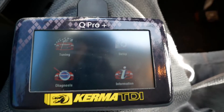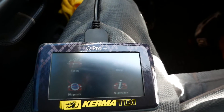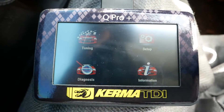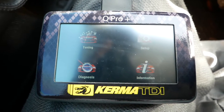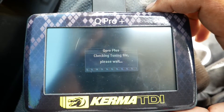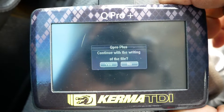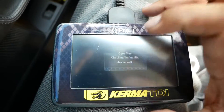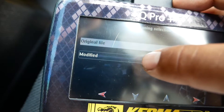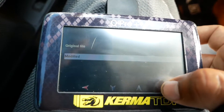So we are back and we plug the Q-Pro Plus with the new file on it into the car. Now you're going to put the car in the on position — remember that. We're not trying to turn the car on, just leave it in the on position. Make sure all your lights and everything are turned off because this does take 10 to 15 minutes. We're going to go to Tuning, looking for the file. We're going to hit Yes. Then we have the original stock and the modified file. You need to put the arrow to the right.